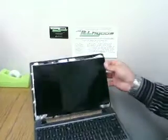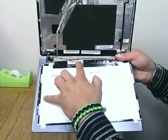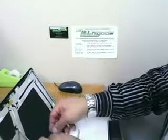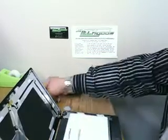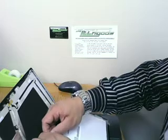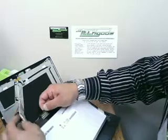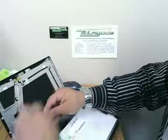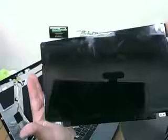So then we can take the monitor — once those four screws are out, this whole LCD will come forward. You'll see on the back there's a piece of tape that holds in the monitor connector, the LCD connector. We'll need to remove that; the guitar pick comes in handy for that — slide underneath there and pull it up. Then these LCD cables just slide straight back out of the connectors. You don't want to bend them or do it unevenly — make sure it slides out nice and evenly. Then this cable can just be pushed to the side. And here's our old cracked monitor, which we can recycle.